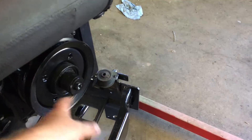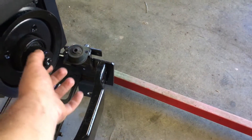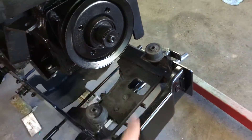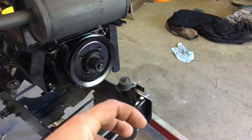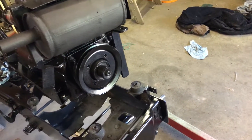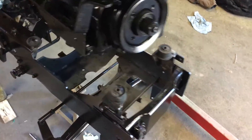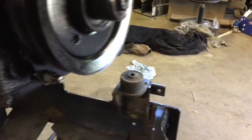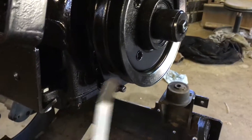It doesn't take too much to pull all this off - just inspect it. You pull off this bolt here, and this is like a bushing or sleeve, and you pull that out. Then you loosen your four nuts here and there are springs behind them - that's a brake on the armature. You pull all that off and you should be able to get right to your magnet. That's another way to also get to your front oil seal if that ever blows.